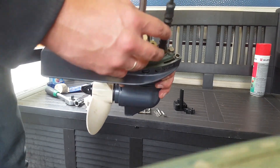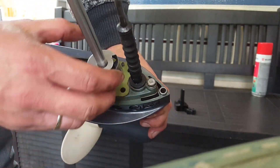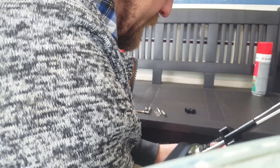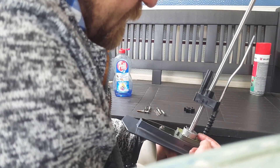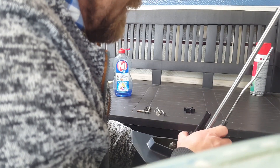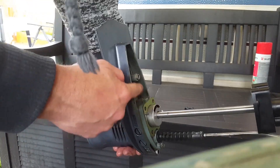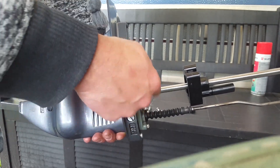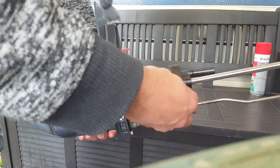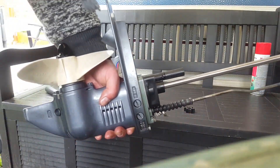To fit this inside without damaging the impeller I recommend turning the prop. This has to go in like this, because the water is going up inside here — the impeller pumps it up through these cases. This has to be positioned correctly so the water goes up and through these pipes. Now it should fit — click.